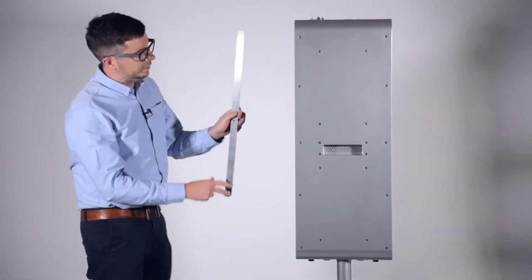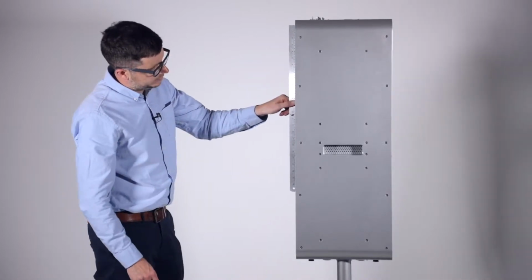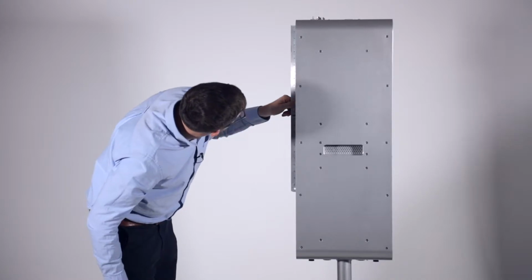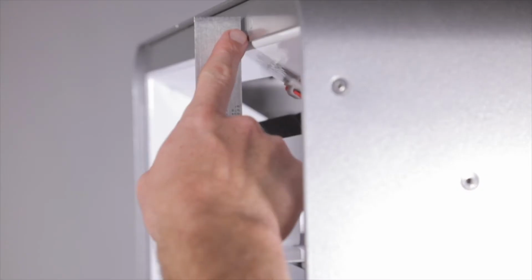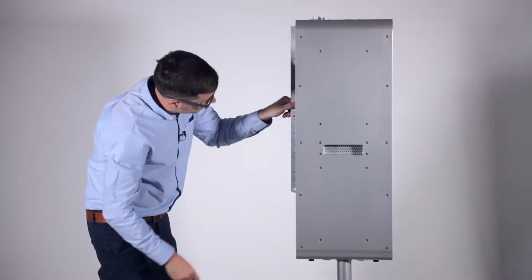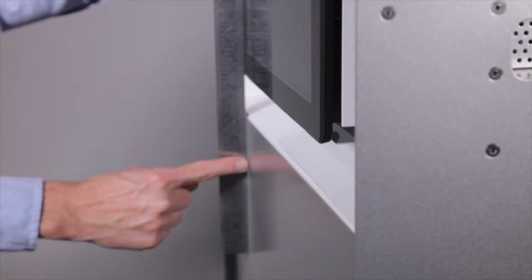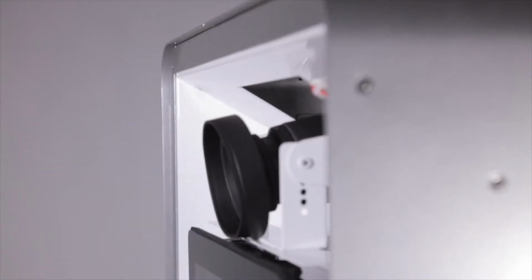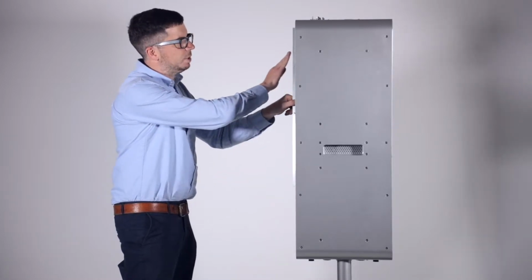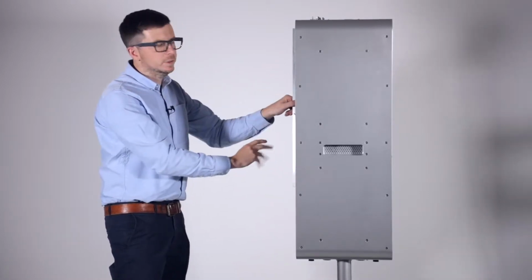And if we just put this straight edge against the screen, we can see that there's like a millimetre distance here and then maybe just less than a millimetre there. About a millimetre here and quite a big gap at the top. So what we need to do is bring this part of the monitor out a bit and push this part in until we've got it perfectly level.